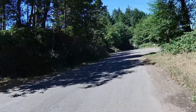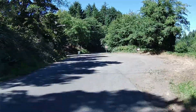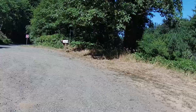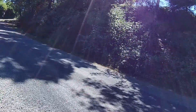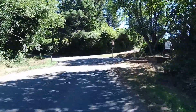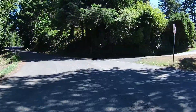Speaking of dust — don't forget about your suspension forks, especially the stanchion tubes. You can see it's dusty right here. You definitely want to keep your tubes wiped down and clean and use a lubricant for the seal around your stanchion tubes. You don't want that dust and dirt getting down in there.